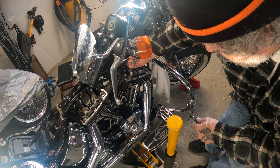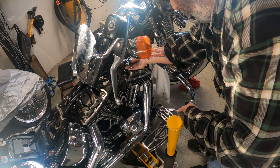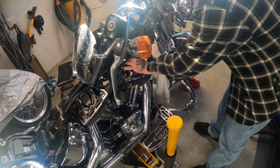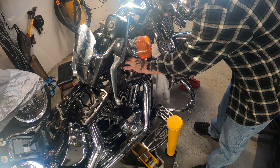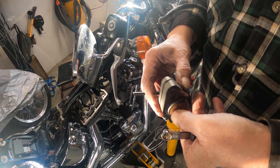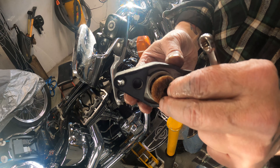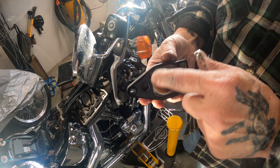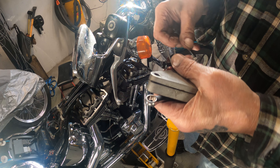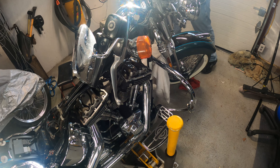We still got to get the motor to top dead center, but you can take this breather off before you do that, because you want to do the smallest bolts first. The four other bolts hold the rocker arms down, but this is just a breather. So we got this breather out, and the whole point of this breather - there's an umbrella valve right there. What that's supposed to do is let air go out, and it's supposed to trap this oil and send it back down into the motor. The bolts on this don't matter - they're the same size.